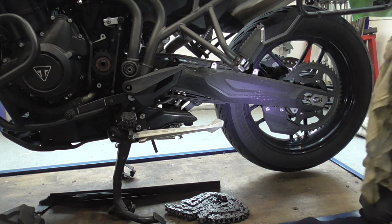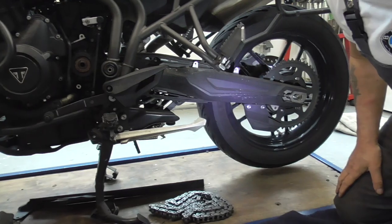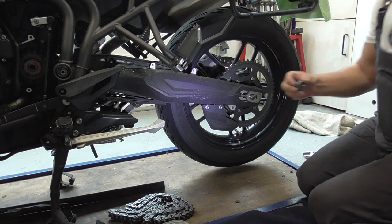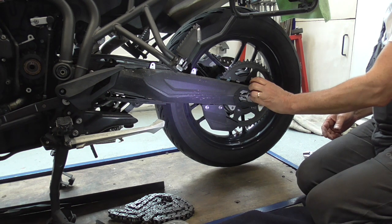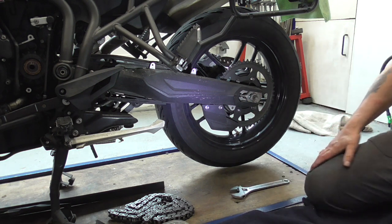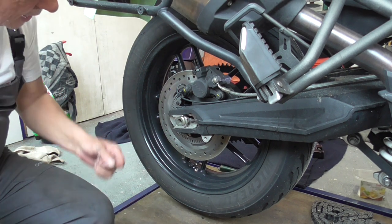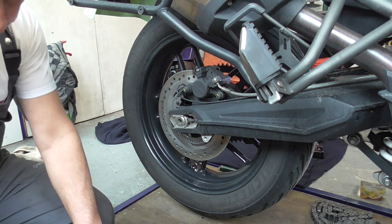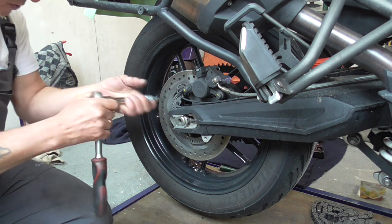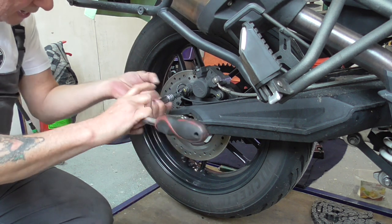Now guys, the next thing we're gonna do. Take the wheel out. Is that easy? Oh, so easy. First, screw this one, 1, 2, 3, 4, 5, onto it. Guys, the next thing, before we take the wheel out, we're gonna remove the caliper. That's also very easy. First, we're gonna get the ABS sensor out of the way.